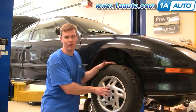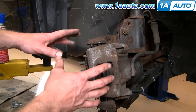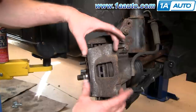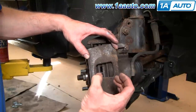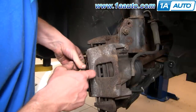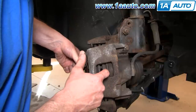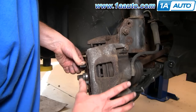You need to check the condition and know what you're looking for. So I'm going to take this wheel off and show you a few things. This is probably what you're going to see when you look at it — a whole bunch of brown and gray. If you're looking at it at your mechanic's shop, they're not going to clean anything up for you. But basically you have three main parts: your calipers, which are like the arms on your bike when you pressed the handbrake and they'd squeeze the rubber shoes together. Then there's your brake disc or rotor, which is like the rim of your bicycle. And between your rotor and your caliper are your shoes, which have a metal part and a brake lining part.